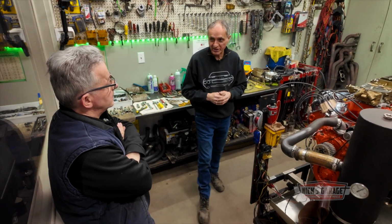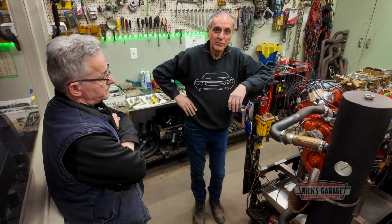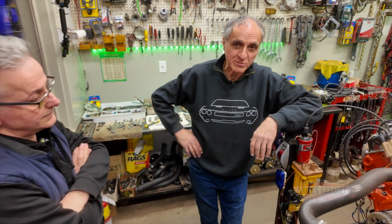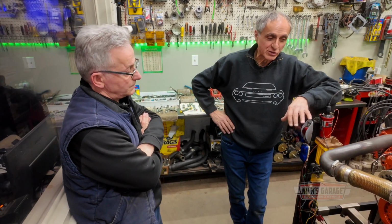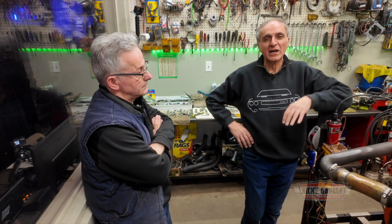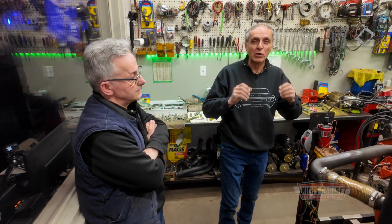I want to see what my clients are going to say. Agreed. And after all, there we have it. I'll be back tomorrow and we'll see what happens. For now, you guys, there you have it, 446 pack. We dropped down the compression ratio a bit, just in case my clients go to a 91 octane. It's going to work perfect. Today I'm using 94, playing with the timing, but it doesn't matter. At least now if he wants 91, he'll be okay.